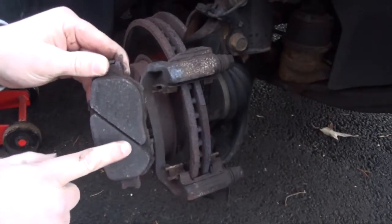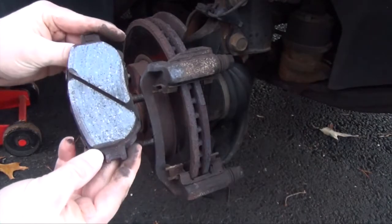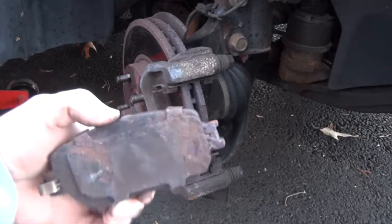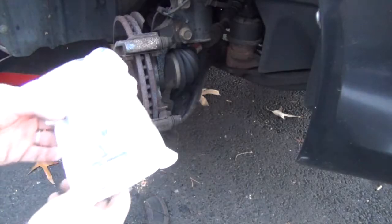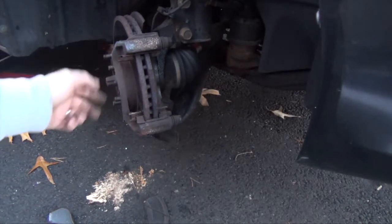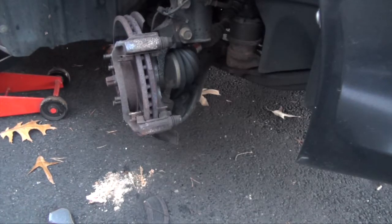This is the surface of the brake pad that actually comes in contact with the rotor, and there is a metal clip that we may need to pull off if it's not on the new pads. These are the new pads and they actually have the metal piece on the back already. The kit does come with all these new rattle clips, but I'm probably not going to replace any of these unless they're broken — I'm just going to clean them up and put the new pads right in place.